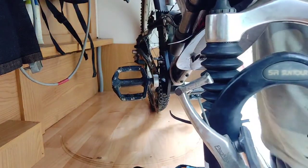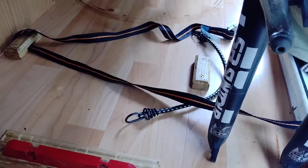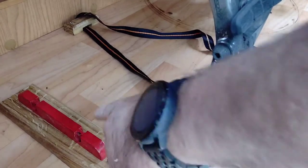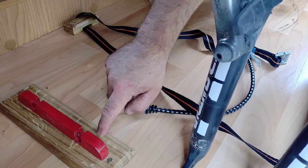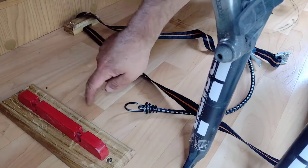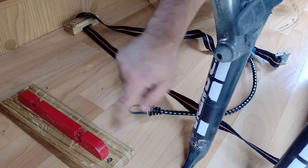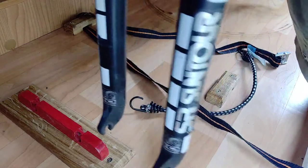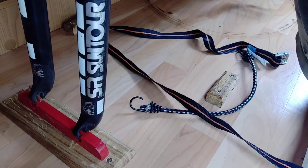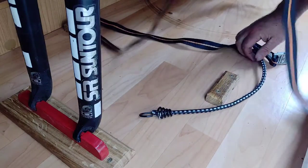Let me just show you this without the bike on. It's a bit awkward there because it's sort of minimal space and there isn't a very wide angle lens on this camera. So there we go - that is the actual little mount that I've made. It's made of beech and this is made of oak, and I just screwed it on with a bit of glue from behind, then screwed it through the floor. Make sure the screws are long enough to go right through the floor so they're actually poking out the bottom of the camper - it's surprising how thick these floors are with all the insulation. You can see a little recess here for the forks to sit in, then using your two cleats you strap it into place.